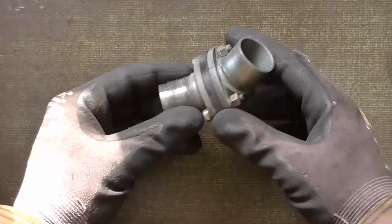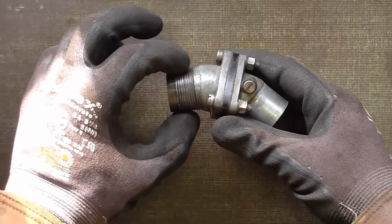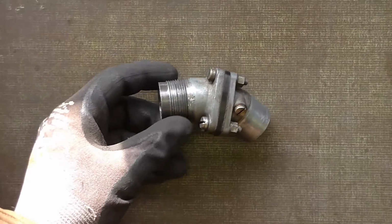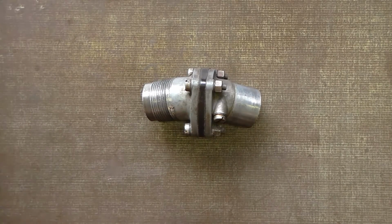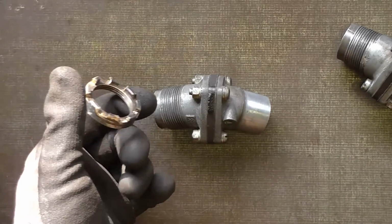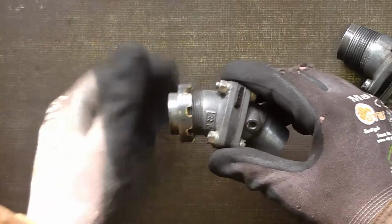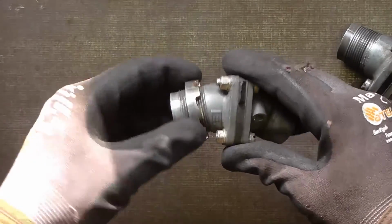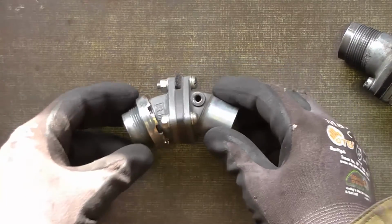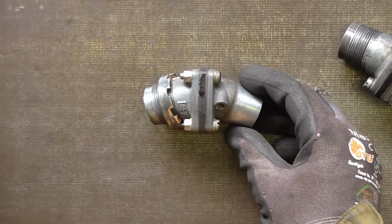But this inlet manifold, they've obviously had difficulty keeping it tight, and it's fretted and the threads are worn. It's really hard to see it on camera. It's very easy to feel it. So I have a reasonable stock of the early manifolds, so I've gone and found another one, and I cleaned up the locking nut, and I'll install it with some thread locking compound, but of course I've got to get the angle right. So I've set it up with the air box and the carburetor inlet stub, and we'll get that on there, and hopefully this will stay where it's put and solve the problem.